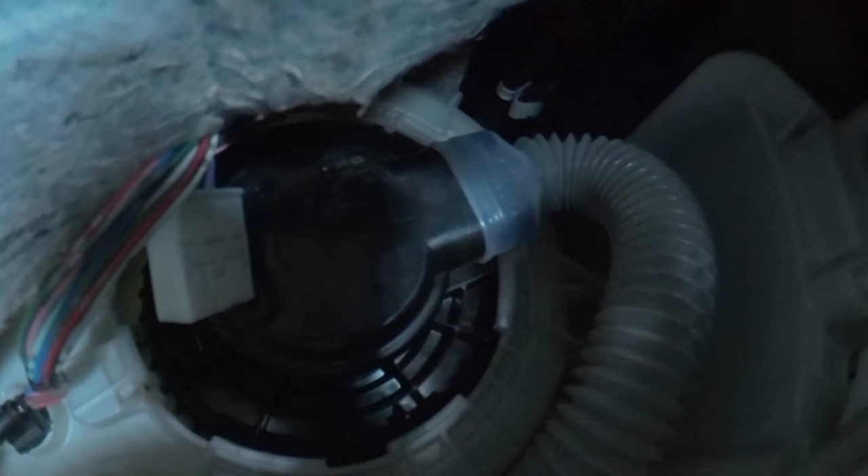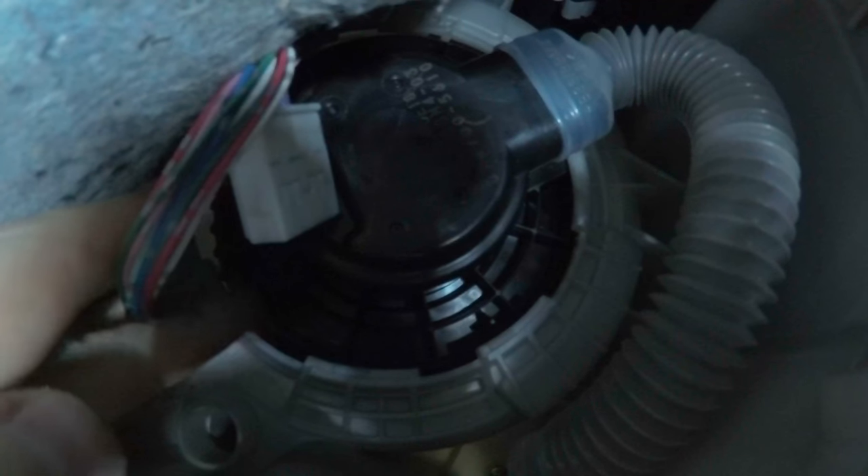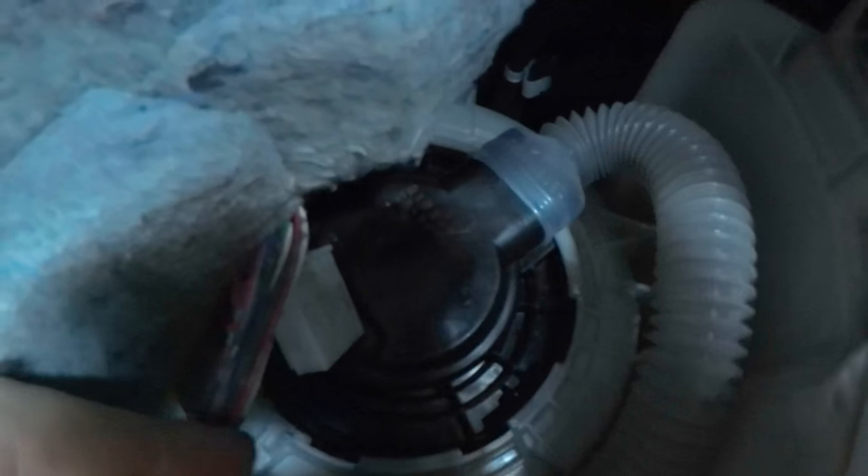Welcome back. I just disconnected the power cord for the blower motor. As you can see, it's quite a small space. The blower motor has been disconnected. There's the tube, which will have to get disconnected. There was a little tab approximately right here — you can see my finger — that's where there was a black release button I had to press, and then it just released. It sits something very similar to that. I hit the black release plastic on the blower motor, and then you can rotate it.